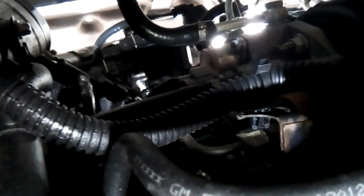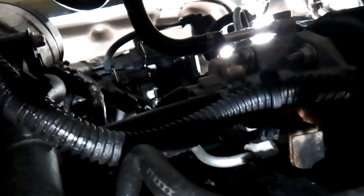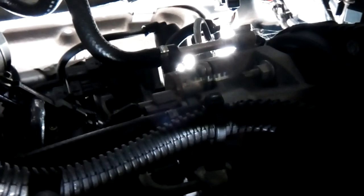So now we're looking at it from the underneath side. You can see it from underneath — if we can get the camera to focus on it there, we can see it in the centre of the picture. You've got the wiring connector to the left-hand side, and you can see one of the torx bolts that holds it in. There's another one on the opposite side to that. So we just need to take the electrical connector off, take the two torx bolts out, and then that'll slide out of place.